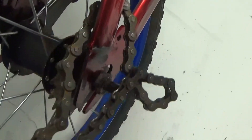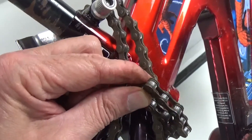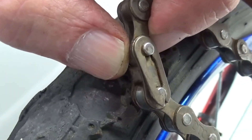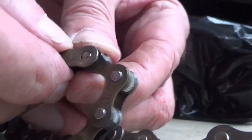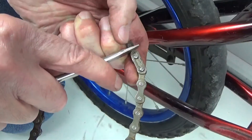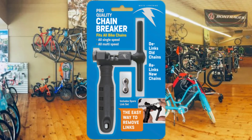You'll notice the chain is still wrapped around the frame. You could go ahead and use the bike like this — just take the chain and secure it around the frame with duct tape or wire to keep it out of the way of the rider. But for this bike, I am going to take the chain off. This chain has a special link where if you pry this part up, you can remove that link and take the chain off the bike. Just in case I want to put the chain back on later, I'll save all the pieces. If you don't have a chain with an easily removable link, you can go online or to a bike shop and buy a special chain tool to help you remove it.